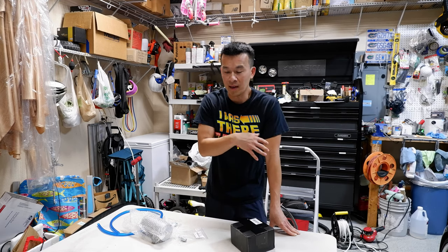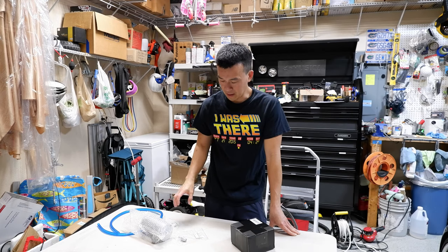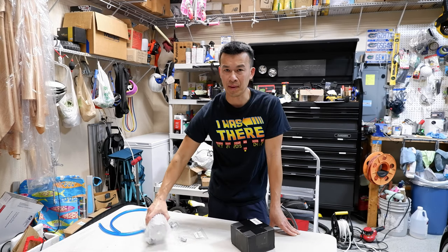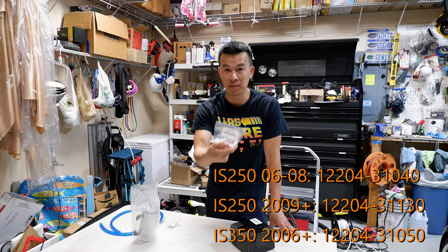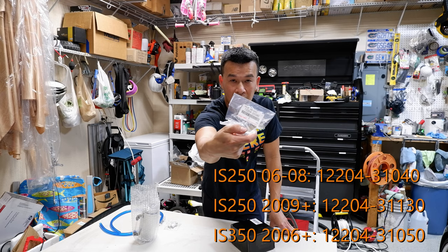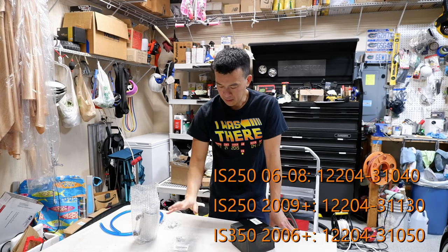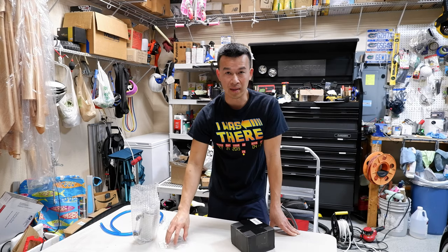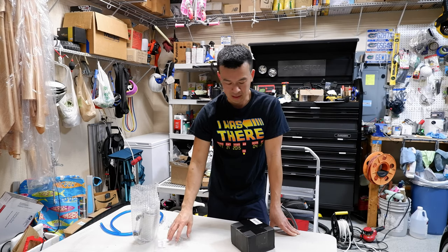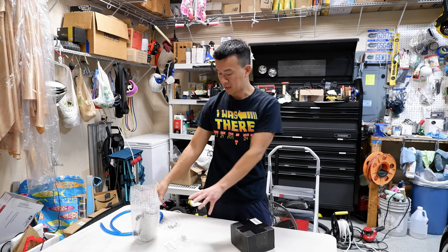You catch most of the oil through this canister before it gets into the engine and into your intake where it's going to gum up the top of your head. So I recently picked up this on eBay - I think I paid like $23, $24 for this. I picked up a PCV valve, it's an OEM PCV valve. That one was like $5 or $6 - pretty cheap, bought it from an online dealer that sells on eBay. And that's pretty much all you really need.